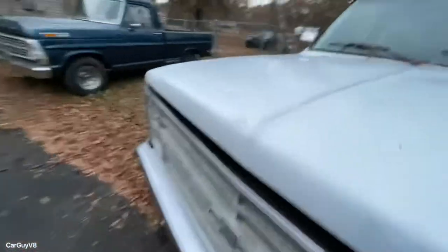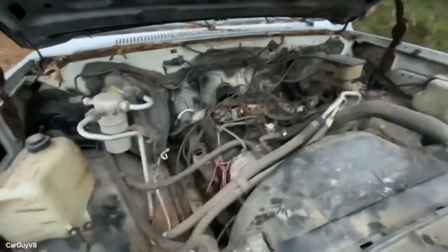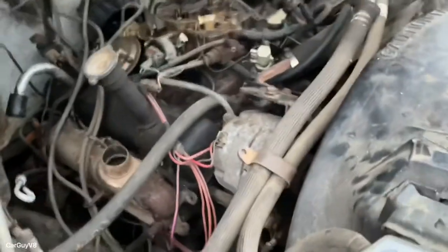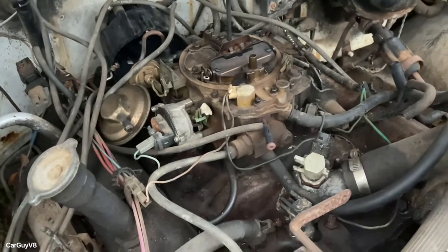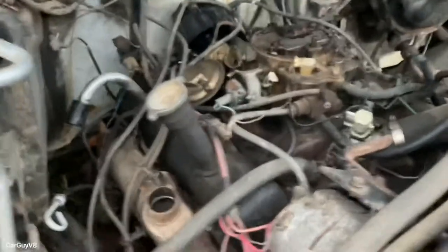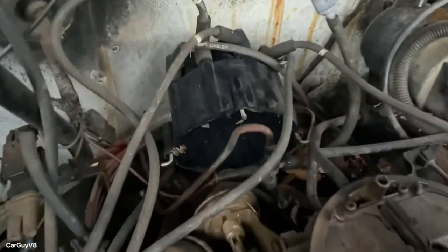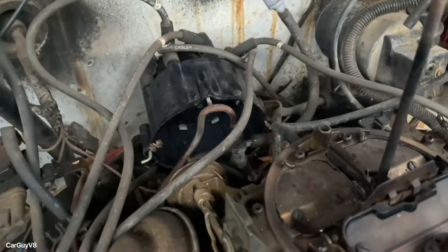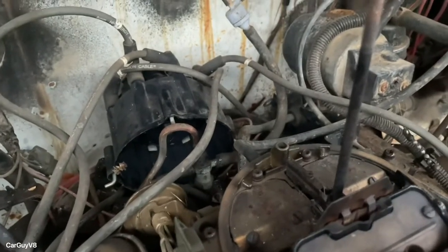Let's pop the hood and talk about what's in it. Since it's an 85, it has the hood latch right there and a hood latch on the inside too. This is an LE9 305 — that was the factory four-barrel 305 combination. Turbo 350 transmission — it's the TH350C, which I believe means it has a lockup torque converter. The truck did not have a distributor when I bought it. A cap was covering the distributor hole. I looked in there, there's a little bit of grass but nothing major. I'm going to flush that out. In the next video we're going to see if we can't get it started up.